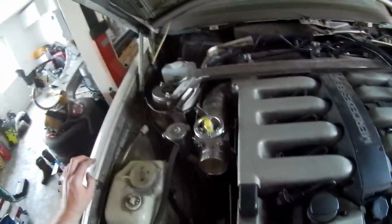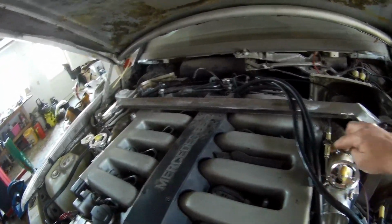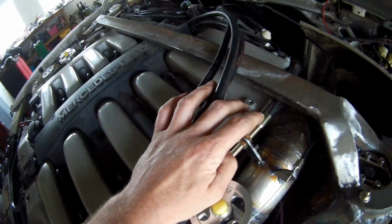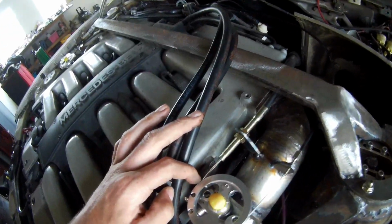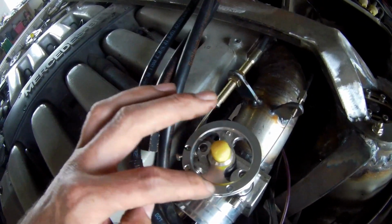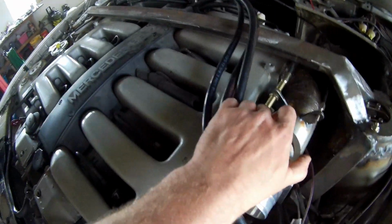So what I also have done is installed the throttle body and the wire. So it's all working now. This is the original wire inside. I put a new cable holder on it. This is the original throttle cable from the 190. What's nice on this aftermarket throttle body is that there are more points you can put something in. So if this throttle body is pulling, it will also open the other side.